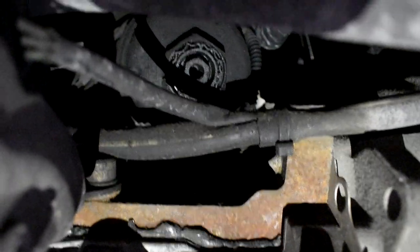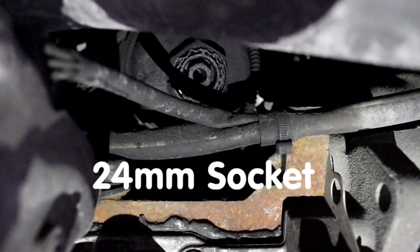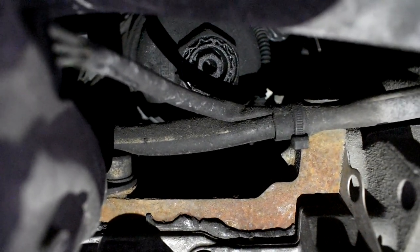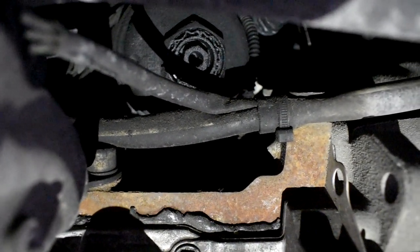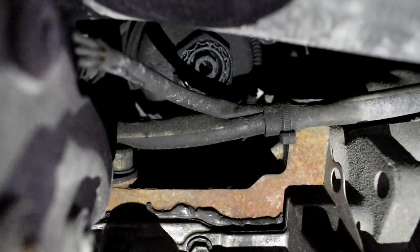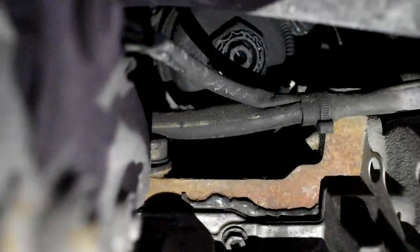As you can see there you've got the main outer nut — I'll put the size of the nut on the screen. And also if you look carefully there's another little nut in the middle of that — that's your drain nut. As the oil filter is pointing downwards, if you just take it straight off it'll be full of oil and it'll go everywhere. So you can undo the middle nut first, drain the oil out, and then take the oil filter out itself.